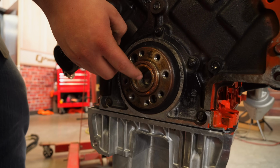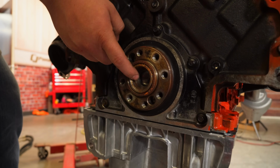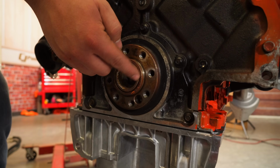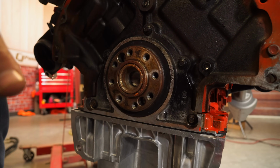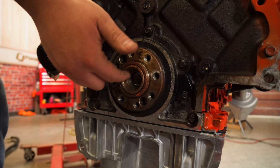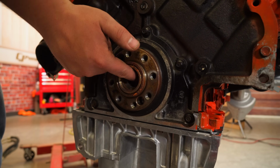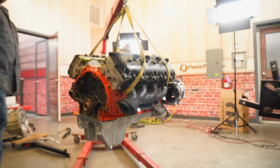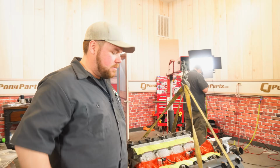Okay. So this sleeve, basically this inside kind of spacer, that needs to be removed. That adapter that we get goes inside of that and acts as this piece. So this piece has to be removed. There's no really easy way, right, Brendan? Nope. You kind of just got to do it. So we're gonna weld a nut on the inside so we can push off of the crankshaft and get that pulled out. That's what Brendan's doing right now, making lots of noise.